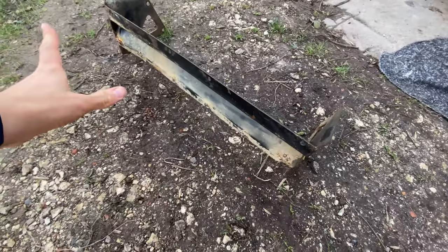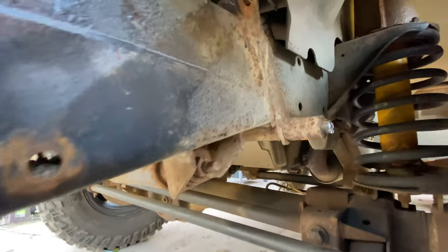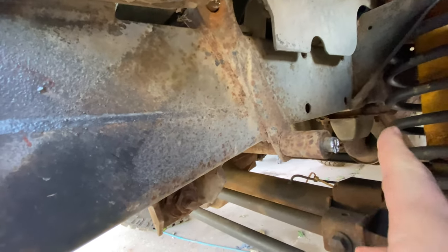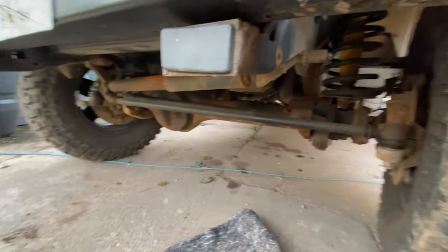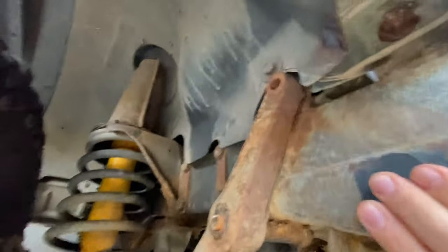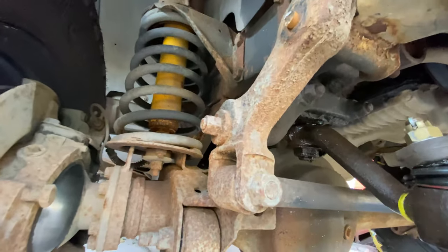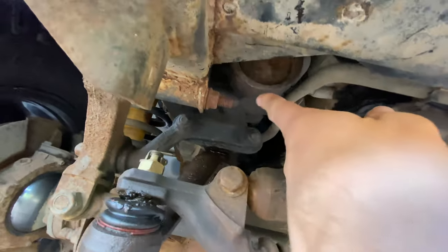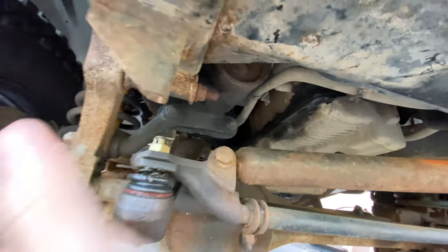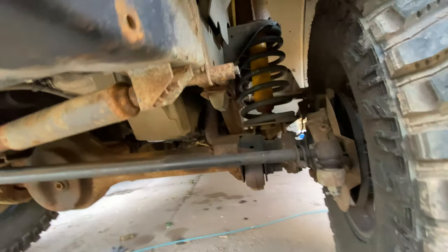I've got the old steering component off, which is all bent — this is what I'm replacing. However, I made a bit of a mistake here. I've ended up cutting the bolt head off here and also here, and this is actually a support structure that I shouldn't have cut off. On the other side as well, you can see there and there — it's been cut off. It shouldn't have been, because as you can see, that links the steering components to the chassis. This bolt here is actually where all the steering guard components go onto, but because the frame was covering all this, you couldn't get inside to do anything, so that's going to need some sorting.